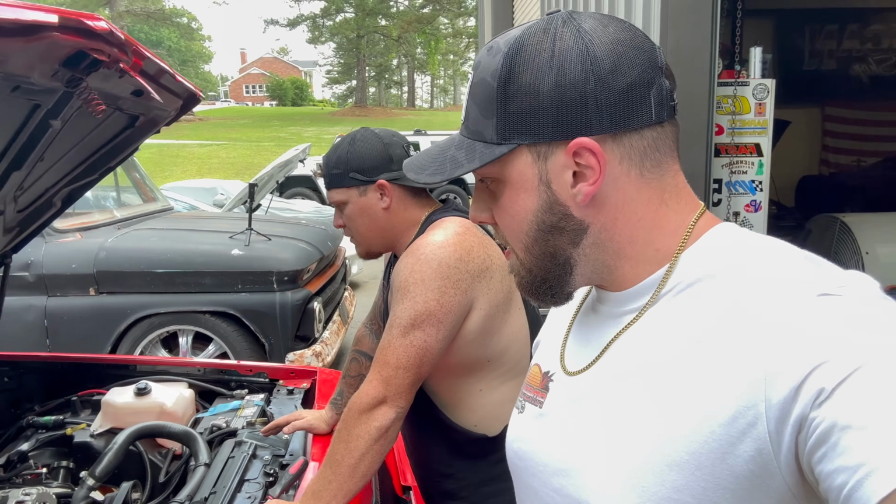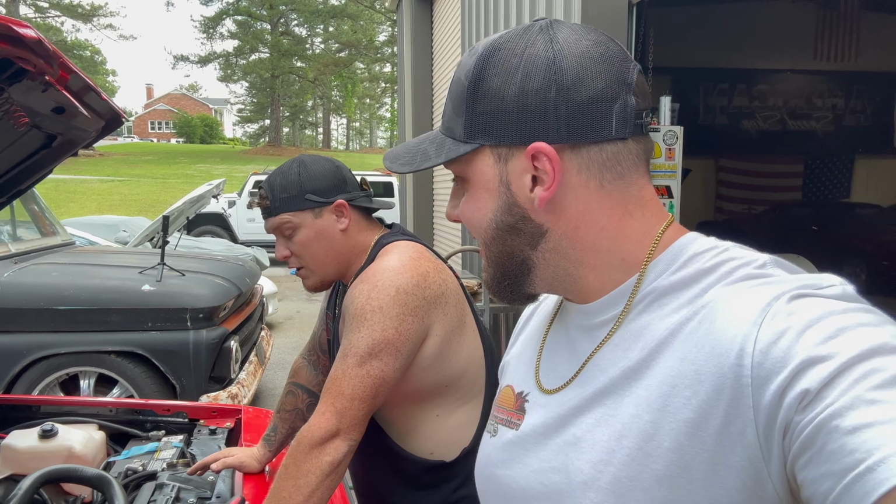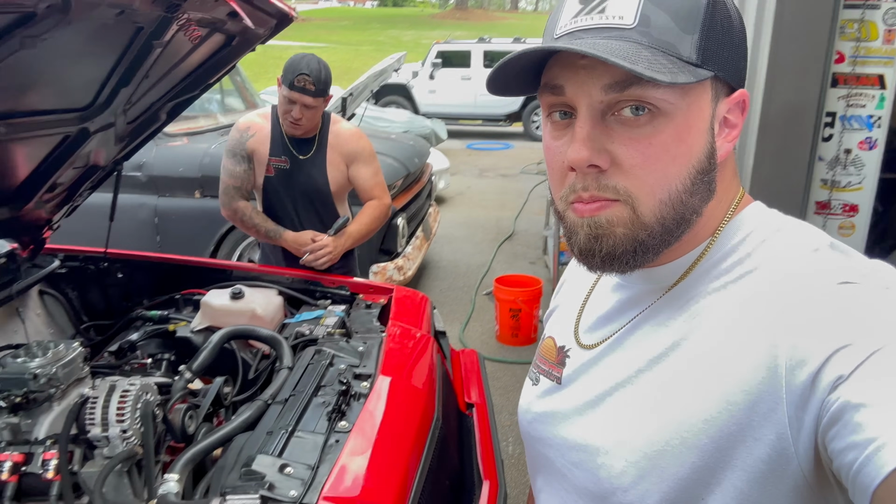I wonder if this is the actual Sniper itself? I just don't understand because we had no problems out of it for 2 weeks. We just dialed the tune up, drove it, plugs, wires, fresh fuel. Yes, it has fuel. No, it's not hot, because if it got too hot, it would pull timing and run like shit.